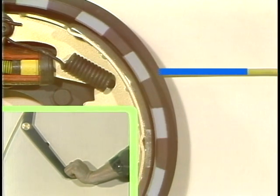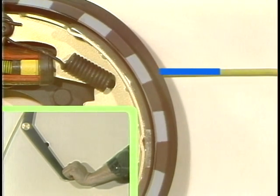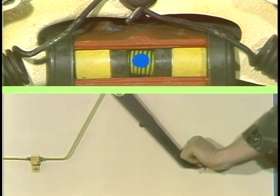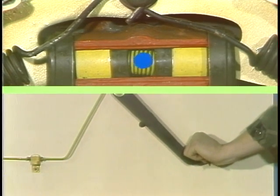The increased pressure in the brake fluid presses against the air bubble, and it shrinks. Let's say the air bubble gets forced into the wheel cylinder. Plainly, the full force generated by the master cylinder piston is not being transmitted to the wheel cylinder pistons, and brake pedal action feels spongy. It takes a lot more pedal pressure to bring the wheel to a full stop, and the air can cause uneven vehicle braking.